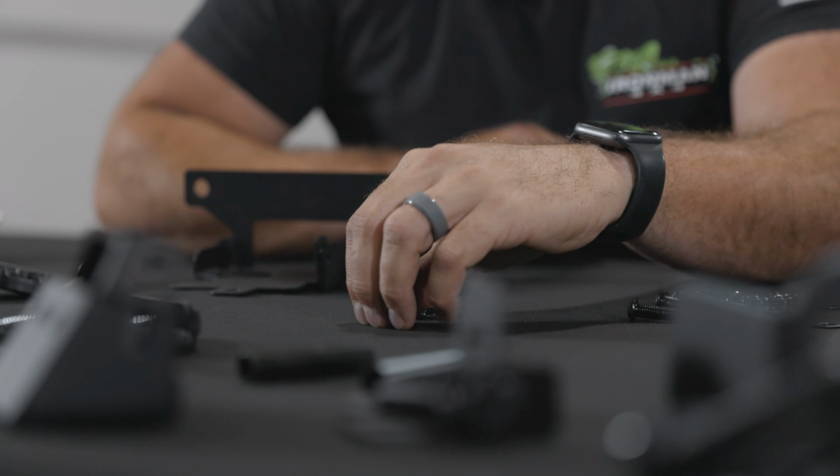I'm gonna pull this wire up with me. The bottom needs to fit underneath the radiator. And this just lines right back up. Don't forget, we gotta hook this back up. You don't have to do it right now if you don't want to, like if you're tired or something, or if you're busy, but I'm here, so I'm gonna do it now. Now we're gonna get those 4 bolts and we'll put them back. Nice and easy, pleasy, because it's plastic. There we go, 2 on this side, and this grill is back on.